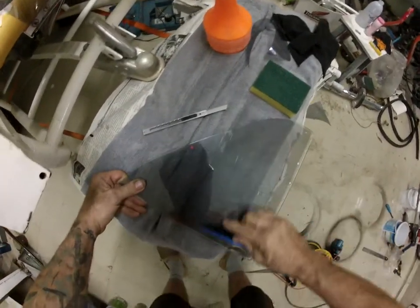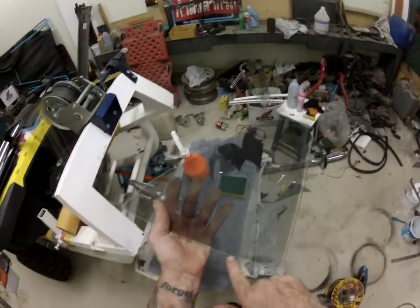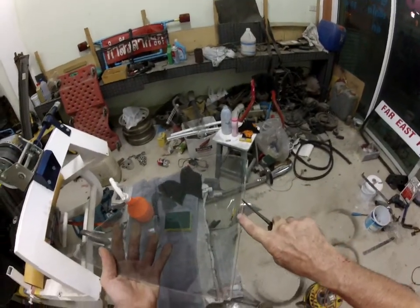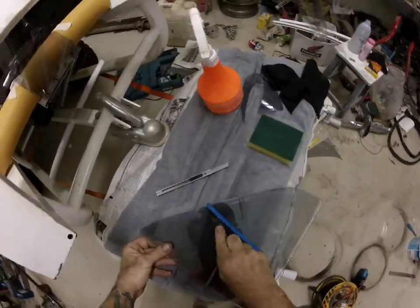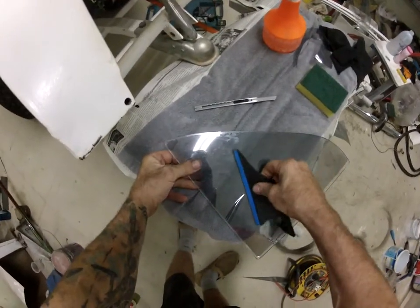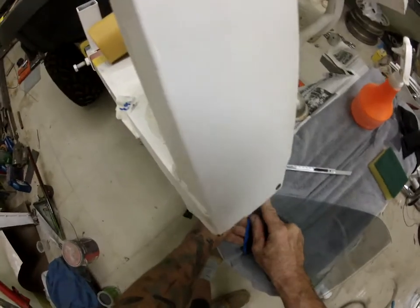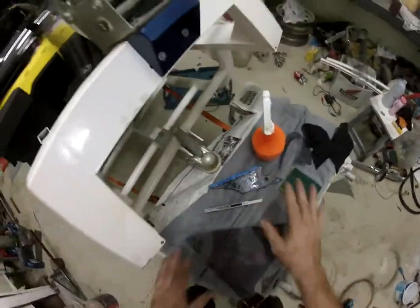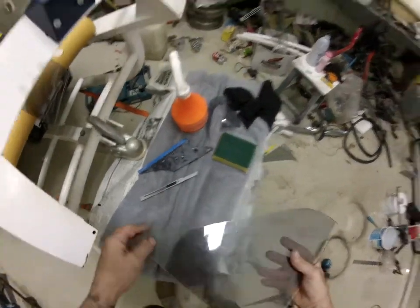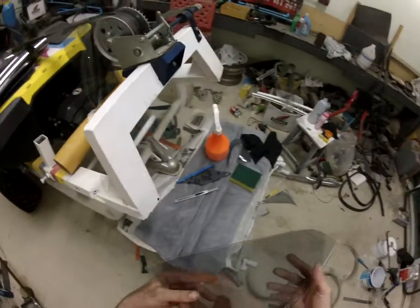Right, final rest in place of this film. It's gone a little bit over — yeah that's gone over there — but we're still inside the dirt line here where we need to be inside the dirt lines, so nothing's going to show. When you put the rubber on you've got to be careful of the very top corner, sometimes it can be nasty. And it's fingering — which is what these are — because of the curve in the glass. As you keep forcing the film around and force the water out you're actually stretching the film about so it will try to finger. You've also picked up some dirt there — there's nothing I can do about that on this application — so we'll leave that to tamp down.